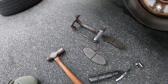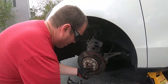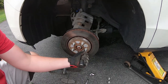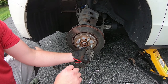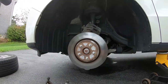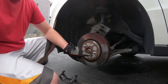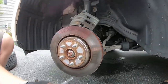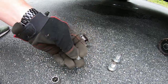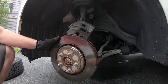I'm using a slightly smaller hammer than I'd like. Before you get started you kind of gently turn the tool in the direction you need to turn it, because inside there's a mechanism that lines everything up. So I got the screw out — what I actually needed was a number three tip and then pound the crap out of it. I kind of ruined it with the number two. I have spares of course. I'm going to try the other side with a number three instead.